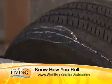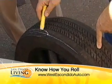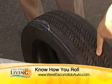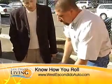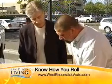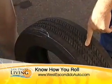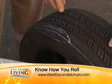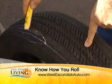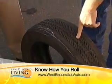How often should I check this? As far as looking at the tires, take a look at them every time you air them up. But when you're getting your vehicle serviced — every 3,000 to 5,000 miles for oil changes — we inspect tires real closely. This can be a very dangerous thing. We all know about the issues Ford had with their vehicles and tire blowouts. I'd recommend checking the tire pressure at least once a month, because that makes a difference in mileage and wear on your tires.